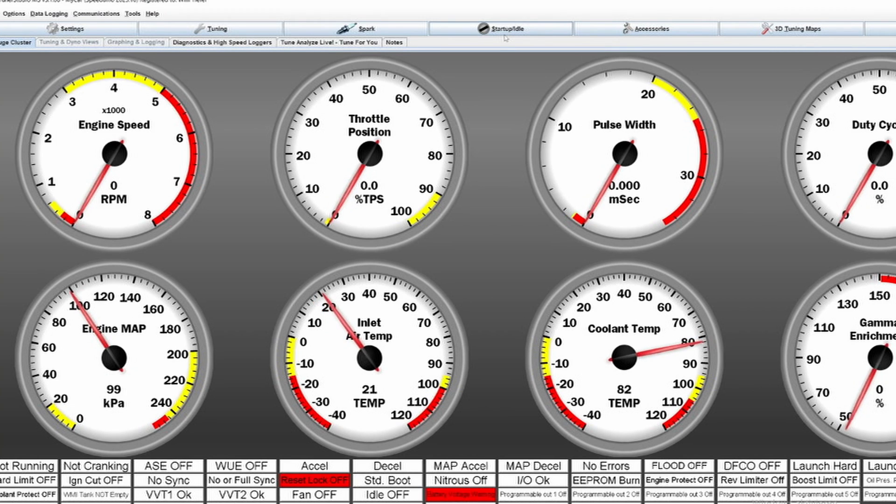On the Speeduino, you don't have as many possibilities as, for example, a Megasquirt unit or ECU Master, where you can dial back boost levels, RPM, or ignition timing based on EGTs or other circumstances while driving. On the Speeduino this is very rudimentary, so keep that in mind when driving on the track — there is not going to be as much protection involved and you have to monitor most things yourself as a driver. This is going to be the last video for the base map, and in the next video we are going to prepare the car for a first startup. I hope you enjoyed the video — give it a like if you did and subscribe to the channel. See you next time.